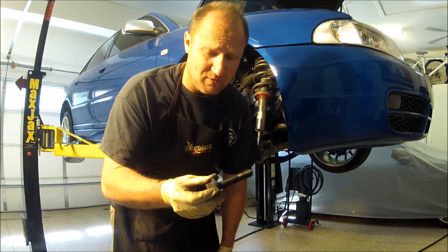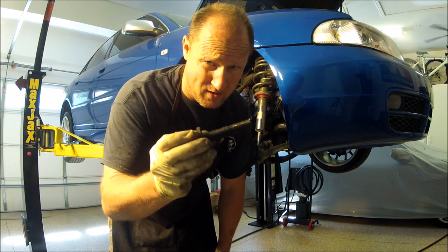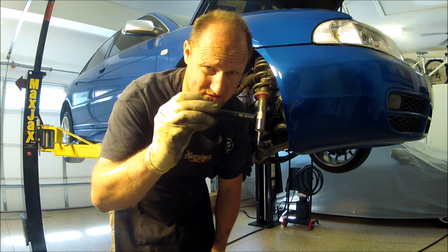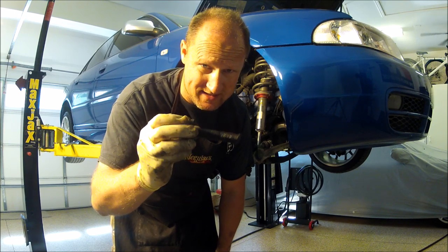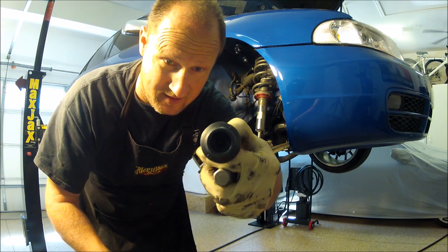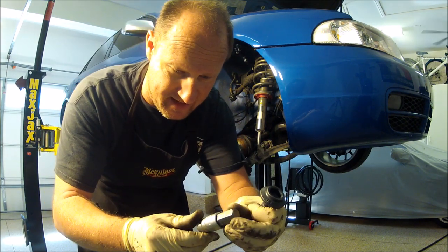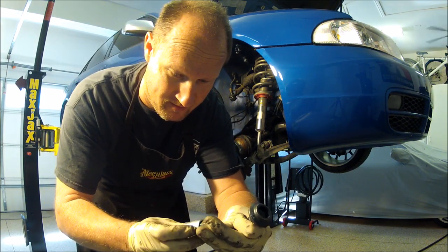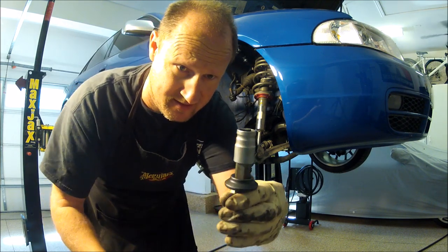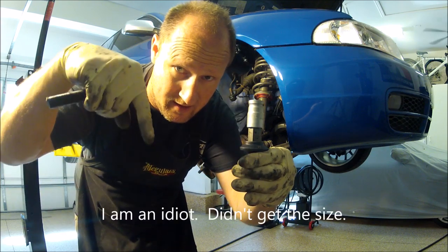One thing I've made sure to replace is the axle bolt. They're one time use, so you put a lot of stress and torque on it when you torque it down, so I would replace this. I have some of these, look, Allen, like OEM, and it's very big. I'll have to look it up and get you the correct size. It'll be right here.